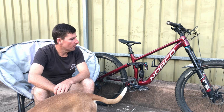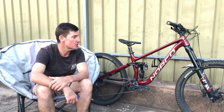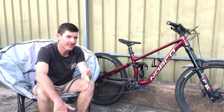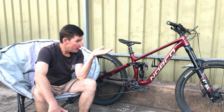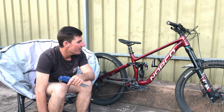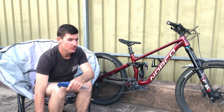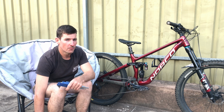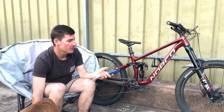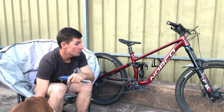So I went back and forth. I went to a token, I went no token, then went back to a token, then went back to no token, a little bit more pressure, and ended up sitting on, for my probably dress to ride, 76-ish. Ended up at 80 psi, 78 psi was really good as well, but just kissing the bottom at 78. But excellent on anything that doesn't have any hard, heavy G outs. Just a smooth performance, heaps of control up the front. Rebound fast, but not really fast. It doesn't really top out, so it's got a well-controlled high-speed rebound circuit in there, I assume.